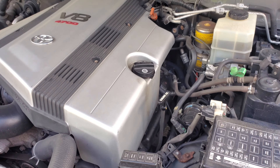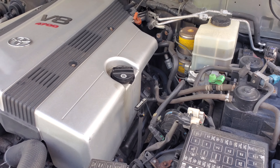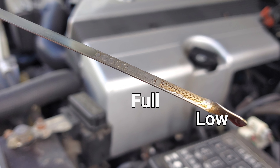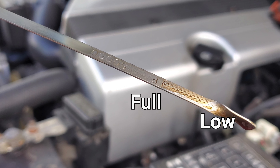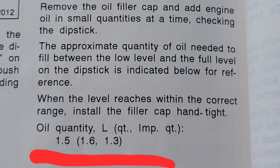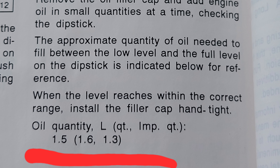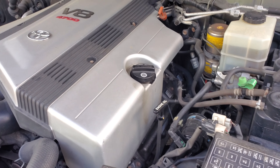And number three, when you're filling it up, keep it simple. This isn't the space shuttle — you don't need to get the exact millimeter up to that fill line. If you're between that low and that high level, you're good to go. You want to try to get it up to that high level so you're a little bit safer. But if you are at the low level or just below it, it's about one and a half quarts for this engine to get it back up to that full line. Don't just dump multiple quarts in because it looks a little low — put about a half a quart in or just below a quart, see what happens, measure it again, and don't keep trying to fill it up to that full line because you can risk overfilling it. Thanks for watching, everybody.